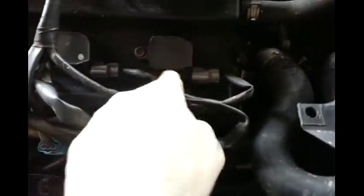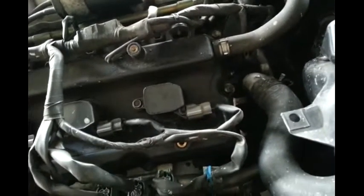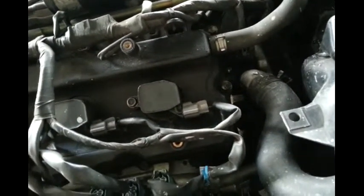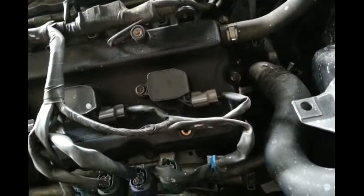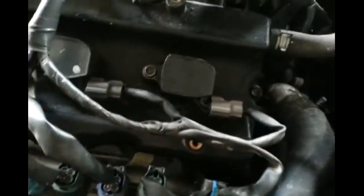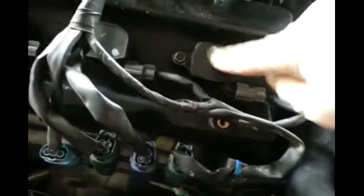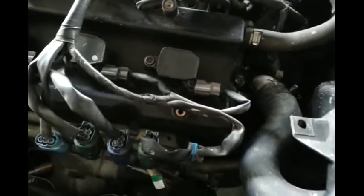So I got the new coil installed. During the process, another thing I did was - when I start the car and while it's idling, I remove this plug right here, and you can feel the engine is still shaking. So that very much confirms this one is bad. But I've installed the new one now, so I'm going to start the car to see. I decided to pull the spark plug from cylinder number 6, and this is what it looks like.